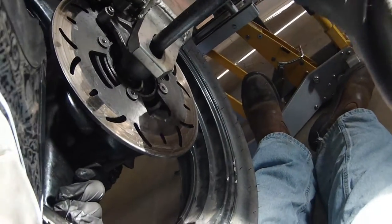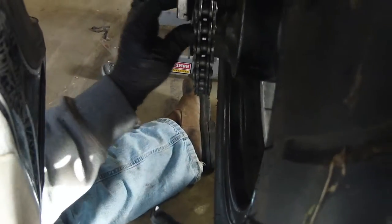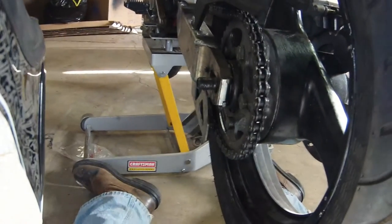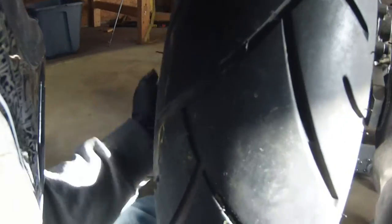Slide those spacers in there, then slide it up, take your axle and slide it through until it gets almost to the other side — you don't want it to pop out because you're going to have to slide your spacers in there. It's easiest to do one on the side or one below, wherever you've got a gap. It'll be a really tight fit, and it'll snug up the extra half mil when you tighten it. Once everything's all lined up, slide your axle on through and tighten it up — they hold nice and tight for a good fitment. That's your rear buildup — pretty simple, doesn't take too long.